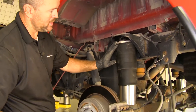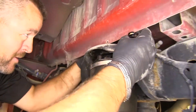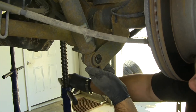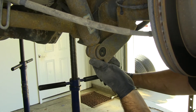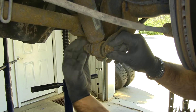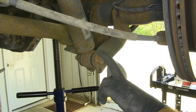Once you get to where you need it and you know it's not twisted, take a 14mm wrench and tighten down the nuts on the top bracket. Next thing we're going to do is reinstall our shock. We can adjust the height with our stand so we can just take our bolt and slide it into place. Once you have that back in place, repeat the same process on the other side.